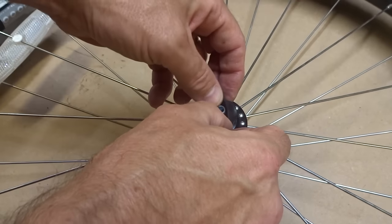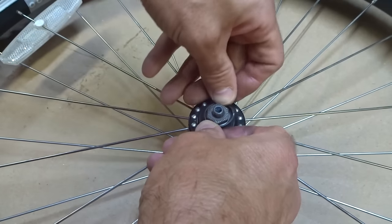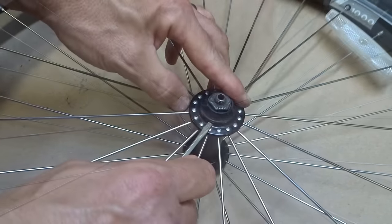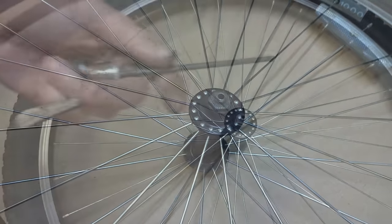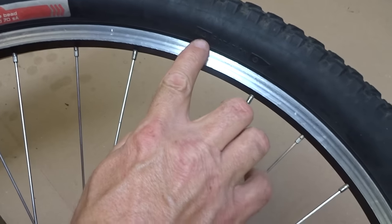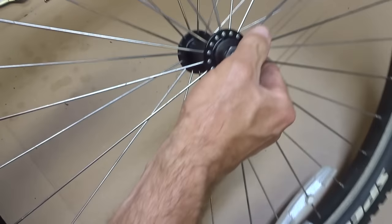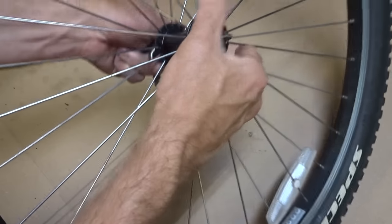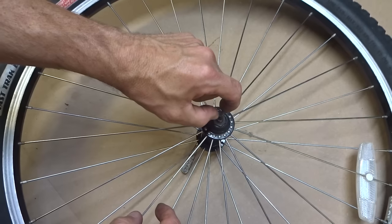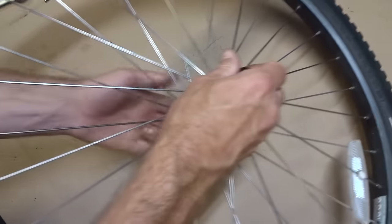Now I'm going to reinstall these little rubber seal things, just kind of slide those over here, try to get them down in — they need to go down over the washer. Now I'm ready to reinstall the skewer. One thing to note is sometimes the tire is directional — in this case the rotation goes this way, so this is the drive side of the wheel. I want to install the skewer so that the lever is over on the non-drive side. Reinstall the little spring with the large diameter part facing the outside and the smaller diameter towards the wheel, then screw this on and get ready to mount the wheel back onto the bike.